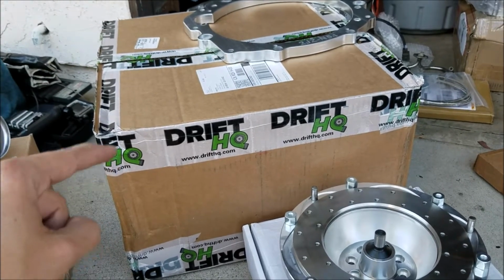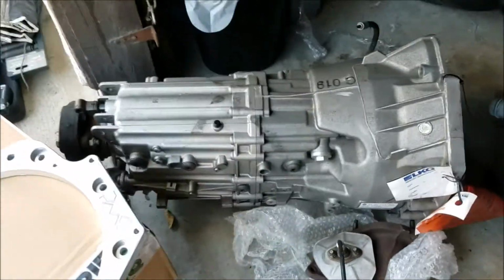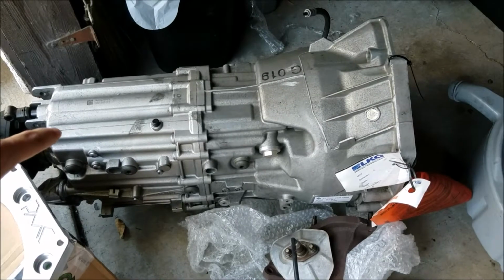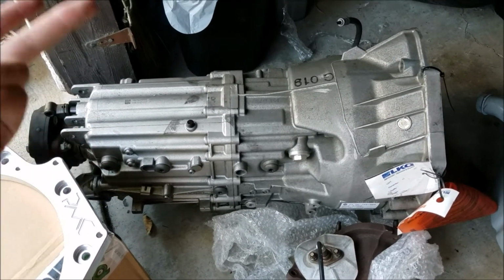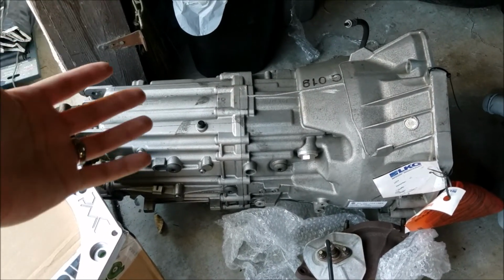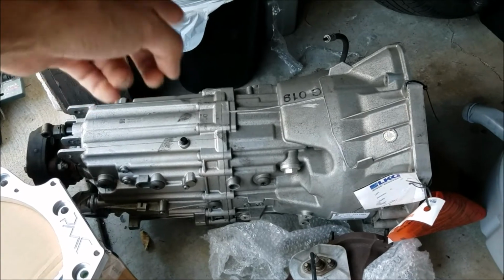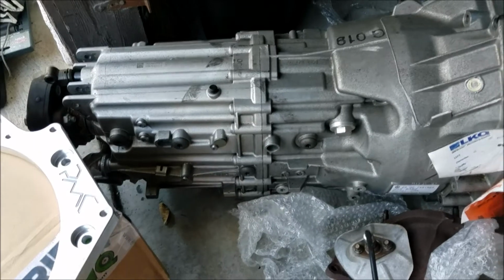And why that is relevant to me is this bad boy over here. This is a ZF GS6-53BZ 6-speed transmission, out of a 2009 135i. But the 135, 335i, 535i, and the E90 M3, and I believe possibly the M5, also use the same transmission. The M3 has a pump for a fluid cooler on the side of it, so it's a different spec and a little more expensive.